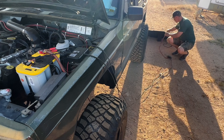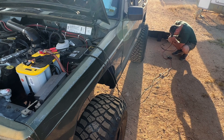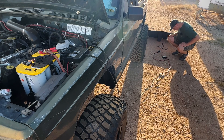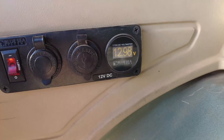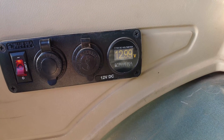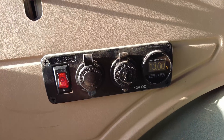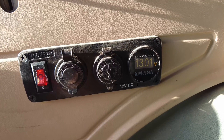Now let's get the solar panel connectors connected. It's showing zero load going in — and awesome, it is charging. The menu is extremely easy to switch between battery styles. With everything connected and the charge controller working, let's check our volt meter in the back of the Jeep. It says 12.98 volts right now and slowly climbing — 12.99 — and it should go over 13 any second. That charge controller will safely charge our yellow top Optima underneath the hood without damaging the battery, even with the alligator clips hooked straight to it.